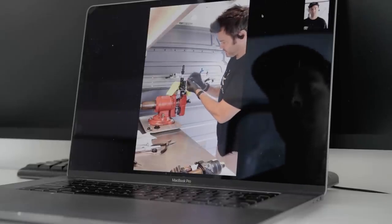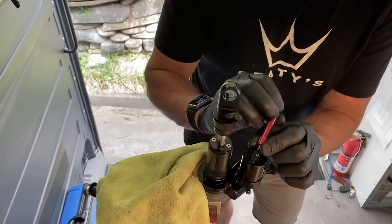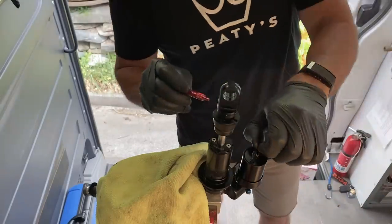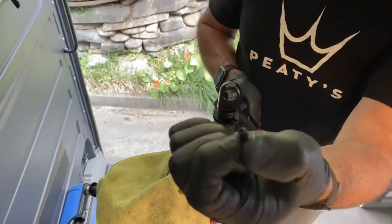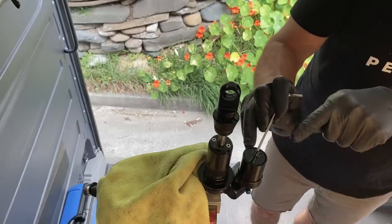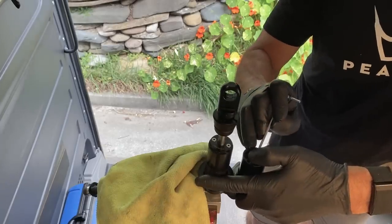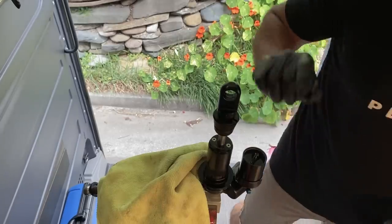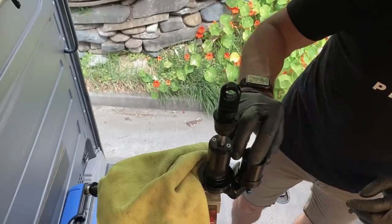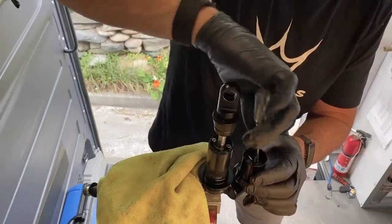This new one is kind of put at an angle. You take your little valve removal tool — same thing, this is just the Stan's no-tubes one for pulling out Presta valves or Schrader valves or whatever. That's just a little cap, and behind that is a Schrader valve threaded inside there at an angle so that it takes up far less room. Just kind of dump the air out of that — it's just pumped up with a regular pump. And inside this thing is another snap ring.